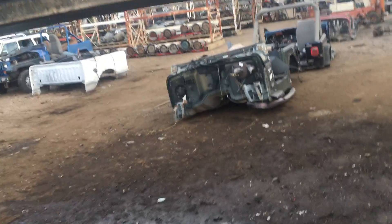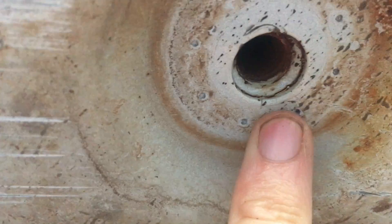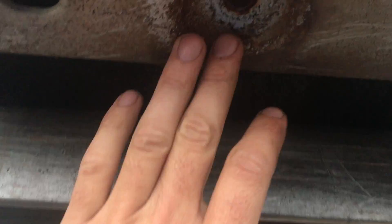It's a good idea to coat these things in something before — even with carpet over it, it just rubs right through. Two major things I want to show you on the bottom: the areas that love to rust. First off are these channels — this one's perfect, but you should definitely keep an eye out. These channels love to rust out, especially in the Midwest and East Coast — they're notorious. They become junk and you can't mount anything to them. I would coat this — there's just a little bubbling here, still solid, but treat it. There's a rubber bushing that goes there and it traps moisture.